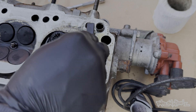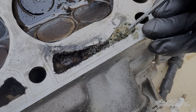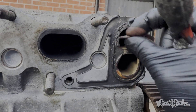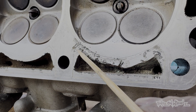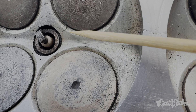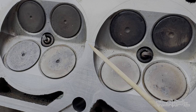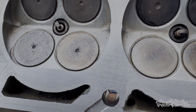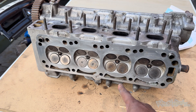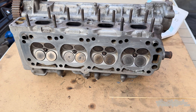Now I know this head's going to need some work, but I wanted to delve deeper. So I lightly removed the baked-on carbon with a soft wire brush. There was also one of the coolant channels completely blocked — crusty. That won't help with heat management around the head. And this sealant — it weren't there from factory and I want to see it gone. With that crust removed, you can see the surface is pitted. That's a weak spot, meaning coolant can potentially make its way into the combustion chamber, and that could be catastrophic. An even closer look shows minute cracks between spark plugs and valves, and even between the cylinders — more potential for failure. Excess heat, previous repairs — who knows? It looks good from afar, but far from good. So this needs quite a few repairs: corrosion, cracks, valve seats, maybe even a skim too — not something I can DIY at home.